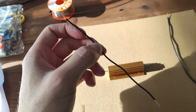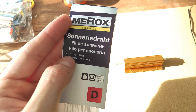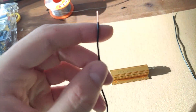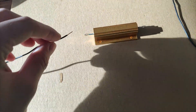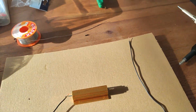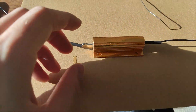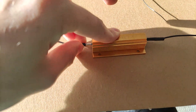Then you need just a couple of stripped wires. I don't really know the exact dimensions, but they appear to be 0.8 to 1.6 millimeters — that's the cross-section. These fit perfectly in the plug, as you'll see in a bit. I'll put them through, solder them, and for good measure put some heat shrink protection over so they're protected from the environment and don't make contact with anything in the car.